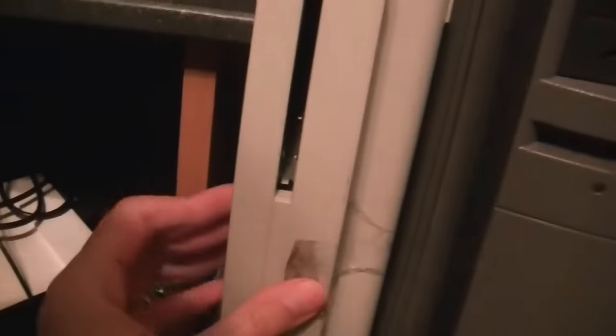I'm going to be honest with you — and frank with you — even though my name is Billy. I don't know much about these computers at all, but I do know a few things. There are a couple of things we're going to need to watch out for on this system that these are known to have problems with, especially as they've gotten older. Number one, the PRAM battery may have exploded and leaked all over the place, completely spoiling our fun. And we could also have a whole bunch of capacitors that have gone wrong. I really don't feel like opening this up right now — I just want to see if the system puts out a video signal. Let's go ahead and do this. Smoke test!